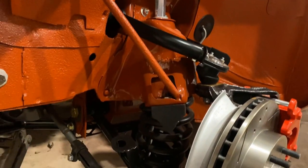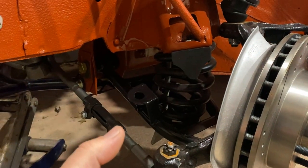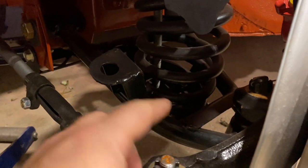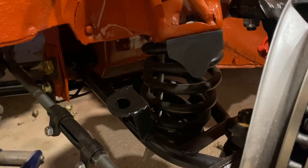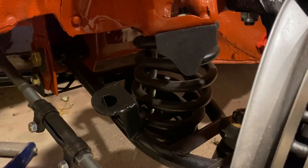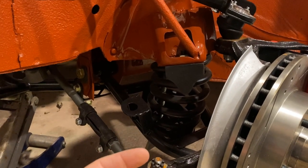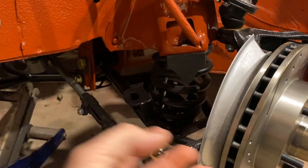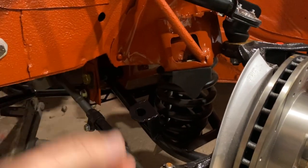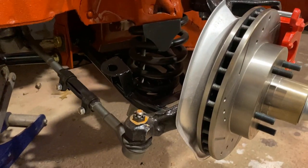Once you get that thing together, get the lower half of the spring compressor on the spring. You can't put it too close to the bottom because if you put it too close to the bottom, you can't get the thing out — it actually pinches between the springs. So you have to go about the third coil to get it into the car and then back out of the spring. I also had to use a ratchet strap because as you're tightening the spring in, it actually wants to swing one way or the other and actually swung out away from the car. So I had to get a ratchet strap and pull it back. But once it was compressed enough, I was able to get the knuckles together and the A-arms connected to the ball joints and locked in place.